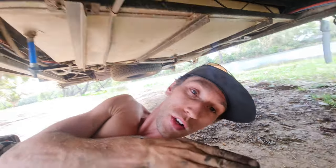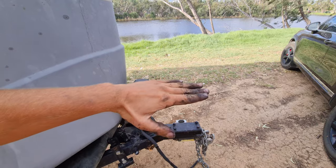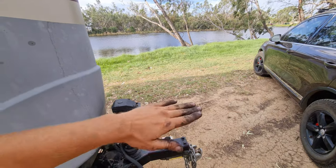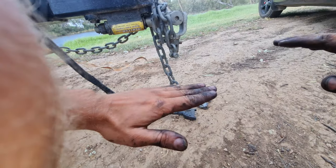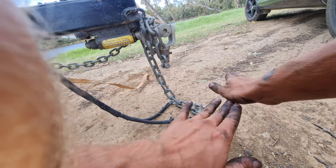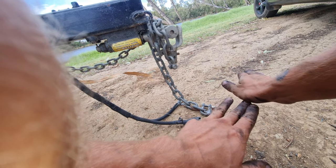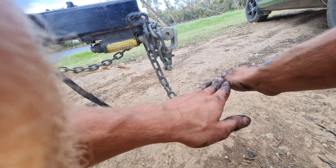There's actually a really good way of figuring out which side is braking more or less. If your caravan's back brakes are harder on one side, it'll push the caravan that way so the car's nose will go left — kind of go away from each other. So if the brakes on this side brake harder, it'll pull the caravan that way which will make the car go that way. So if you put your foot on the brake and it's not perfectly slowing you down evenly and you feel like you're getting pushed one direction, it is the opposite direction to where it's braking. So whichever way your nose goes, it's the other side that you need to loosen up — or the way the nose goes is the way you need to tighten.